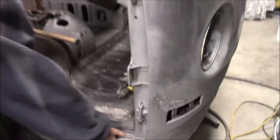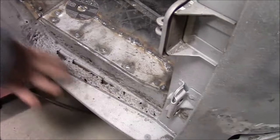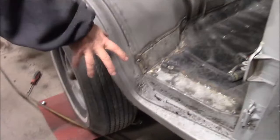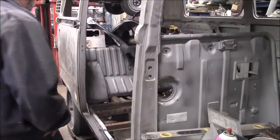In the front section we still have to repair or replace this area. All of these holes and rusted sections — that's what the main floor looked like after it was sandblasted. We'll end up cutting that out and putting in new steel. That's a piece you can actually buy, it's just on back order. On the other side, same idea — we have the new jack post, the new outriggers, and we've reconstructed all the wheel well on the inside. So it's all new steel and structurally strong.